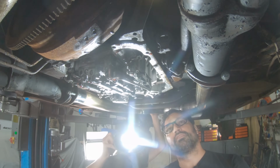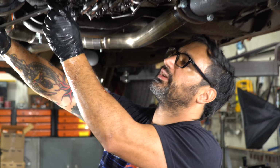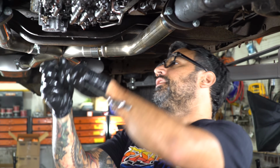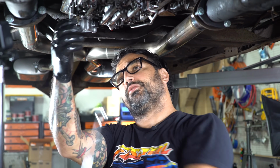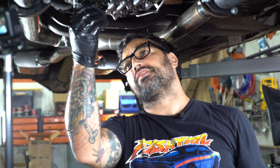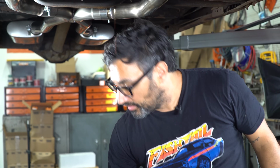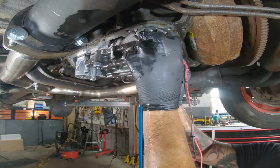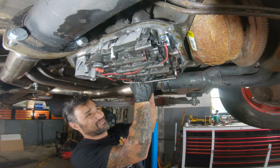And metric. There she is. All right. So this is the 4th gear switch. This is going to ground out when you're in 4th gear. Why do they want you to run a different one? I think because some of them are different style also. So essentially, no matter what 200 R4, if you buy this lockup kit, you'll be in business.